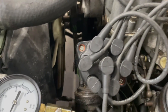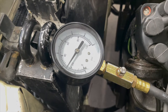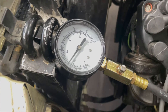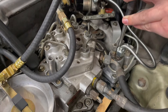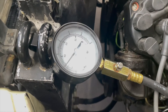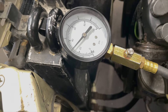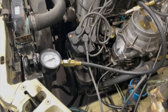We're going to go back to the gauge — we're still about one millimeter up on the fuel cell. If you're tapping on the fuel cell and nothing is happening as far as pressure increase, that means you didn't assemble the unit right and that small pin probably didn't seat into the diaphragm. Look at that — we've tapped it and come right up to two bar. That's our initial adjustment on a rebuilt WUR.